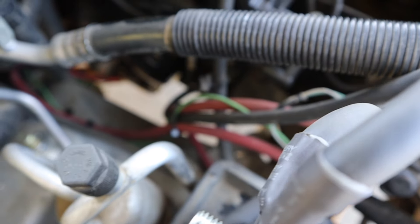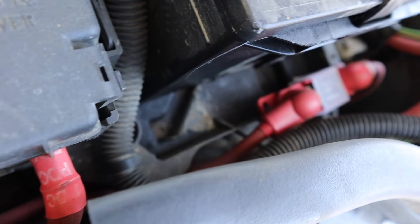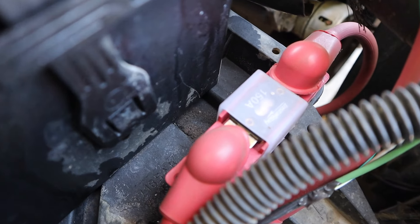The fifth and final modification is upgrading the wiring. This is the Big Seven kit — there's a version for the V8 as well — by jeepcables.com. The cables are a lot thicker than stock, and if you're running winches, lights, and accessories, a smaller gauge cable lets more power flow through with less strain. They won't heat up as much. I had no issues with it — easy to install. I changed mine because I was having power issues with the battery; my Jeep was turning off and it turned out to just be the battery cables.